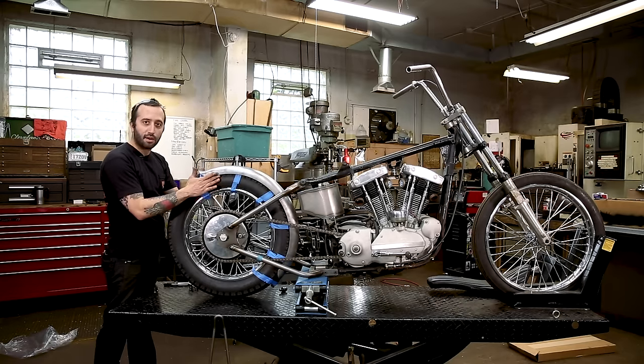So when you're mounting this curved tab, you're gonna just bolt the bungs onto the bottom of the tab and you're gonna hold it up. And I would just take a Sharpie and trace it across the cross tube and then cut off the excess. And then keep the bungs bolted to it and you're just going to hold it up with the bungs touching the fender and the bent part of the tab on the bottom of the cross member. When you're putting this on the fender, you just want to kind of center it on the fender. An easy way to make sure that it's centered is just to try to match the gaps the best you can from the bungs to the top of the fender.